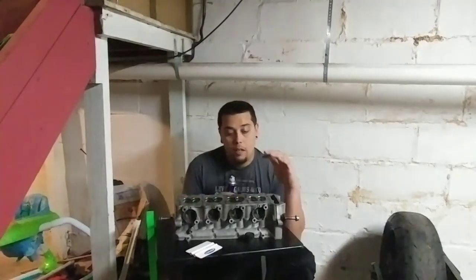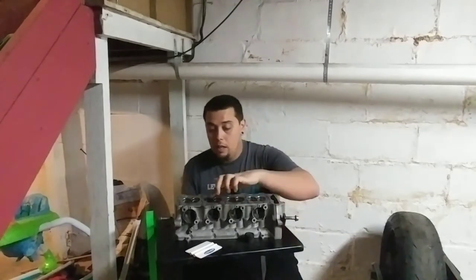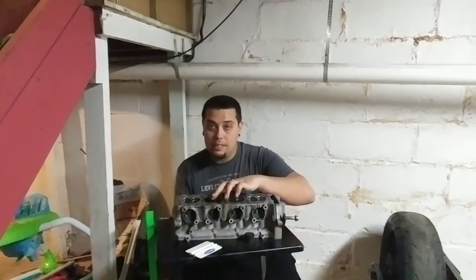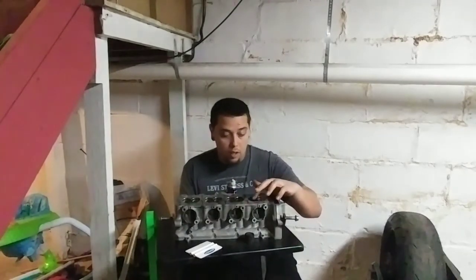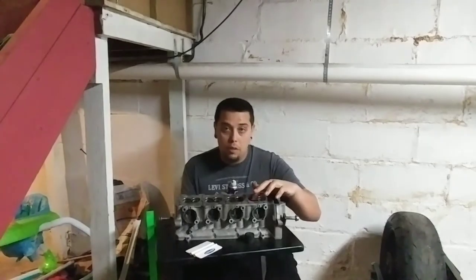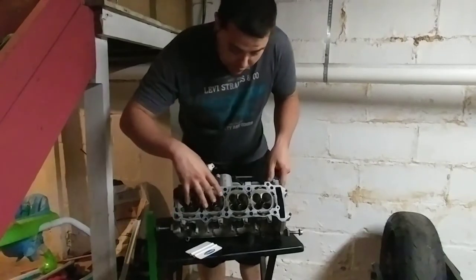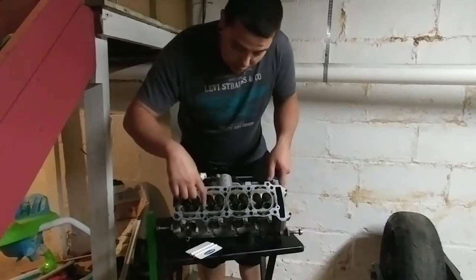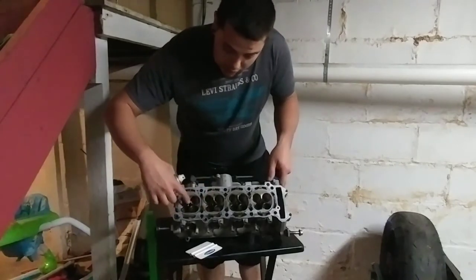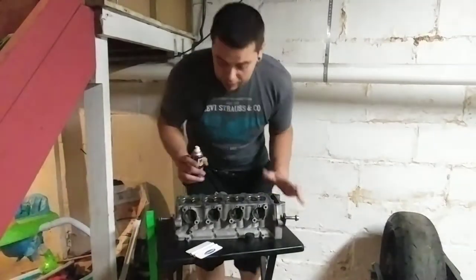I'm going to do the best I can without scraping. When I wipe this off — what I did before was spray it on and rub my finger on it, and this stuff is really hard over here, though some of it is actually kind of wiping away. What you want to do is get everything out inside the cylinder and anything around your valve seats right here. You want to take all of that out as much as possible to alleviate any hot spotting.